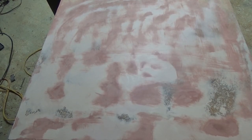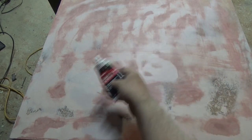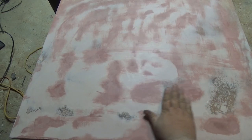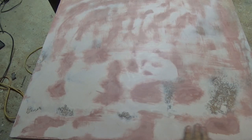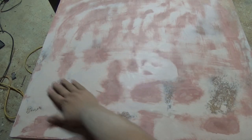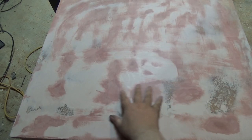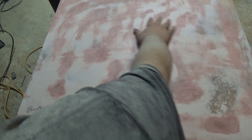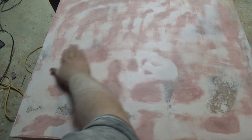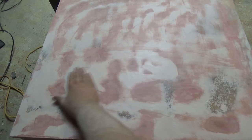Okay, so what I've done so far is I've put glazing putty over this whole area and then hit it with 220 grit paper and a sander. Now we're almost there. It's very, very smooth. But I can feel there's some imperfections. If I feel across, don't worry about different textures. Feel across for low spots and high spots.